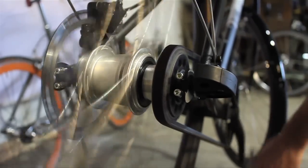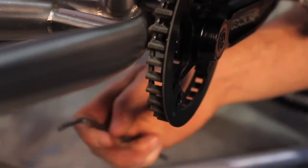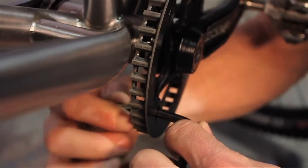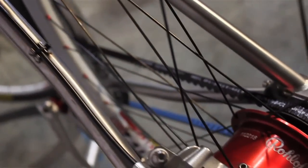There are three typical attachment methods: three-lobed, thread-on, and splined. To install the hub and rear sprocket, follow the steps outlined in Module 2. Then it's time to install the front sprocket. On geared hub bikes, alignment is achieved by adjusting the front sprocket, because the rear sprocket is in a fixed position on the hub and can't be adjusted side to side.